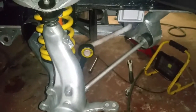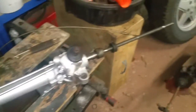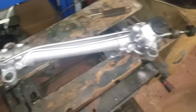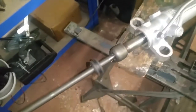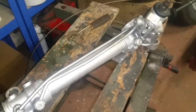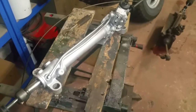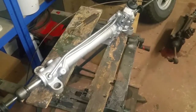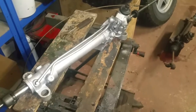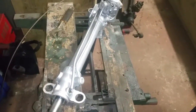All that's done now, so all I really need to do is get the rack built up and fitted. Here's the rack — I've started fitting the arms to it and I'll give it a quick coat of paint. I tested it off the vehicle: I connected it up to the hydraulic lines with the engine running and there were no leaks at all. I'm hoping that's a good rack and it'll all work okay — the only real way to find out is to get it on the car, drop it on its wheels, and see what happens.